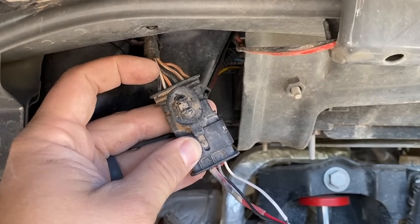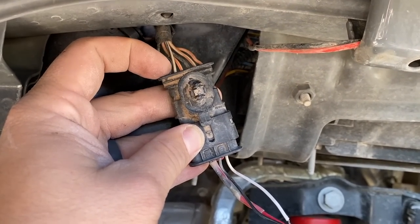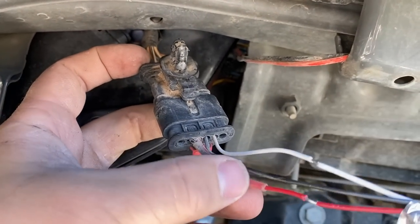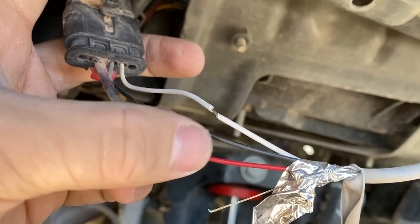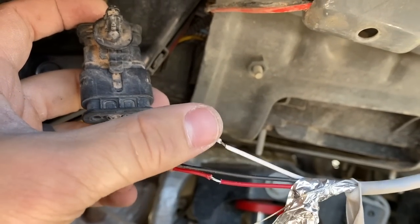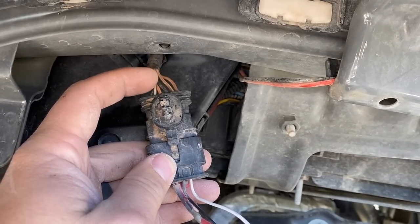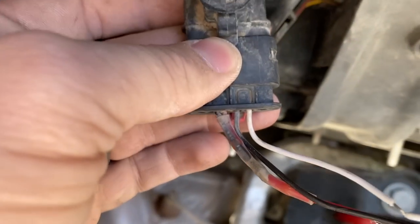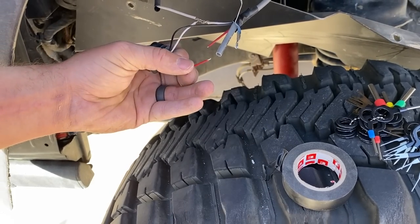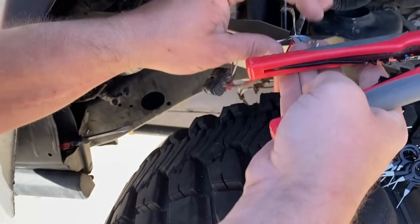For the turn signal — on the driver's side it's the white and green wire. It runs into the second from the left line, which means it should be coming out the second wire from the bottom, which is the red one. I split it open and tried tapping into it but it wasn't working. I tried the white one, which leads to the orange and white, and that one got the turn signal working. So on the driver's side it's white and green; on the passenger side it's orange and white. If you made a mistake like I did, don't fret — we can fix it by just cutting the line, soldering it back together, and using a new heat shrink seal.